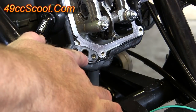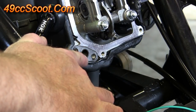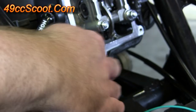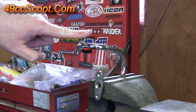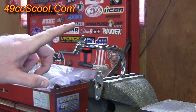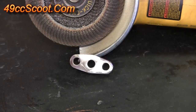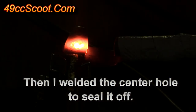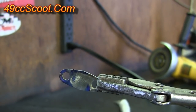Back over to the engine, you can see there's still a hole in the head that needs to be plugged up. You can get a block-off plate from NCY and just bolt that on, or you can make your own — it really just needs to be a piece of metal with the right bolt holes to match up. Bolt it on with a gasket and seal it off. I'm going to make a block-off plate out of the old components. I've got this in a vise — this is the end that bolted up to the head. I'll go ahead and saw it off, flatten it with a grinder, remove all the chrome plating, grind the welds flat on both sides, and once it cools apply some paint.